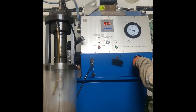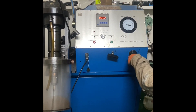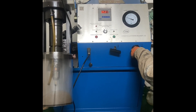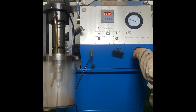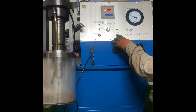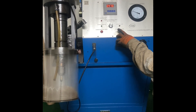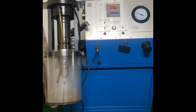Then lower the pressure. We have to find out which is the lowest pressure that gives good atomization. Finally, we got the valve opening pressure — the injector is at 547 bar. So the injection valve is good for use again.